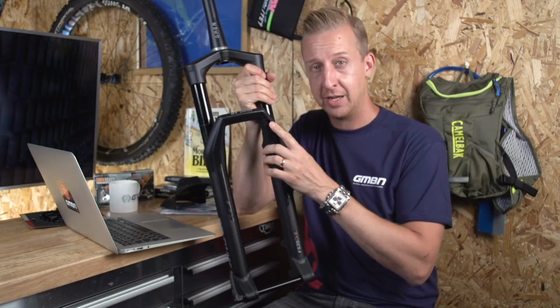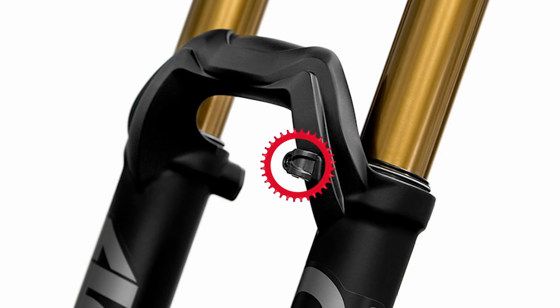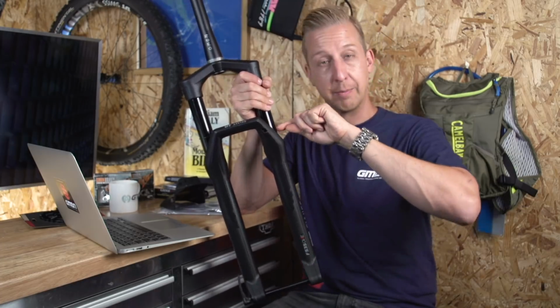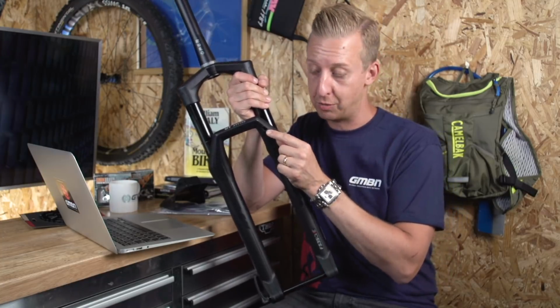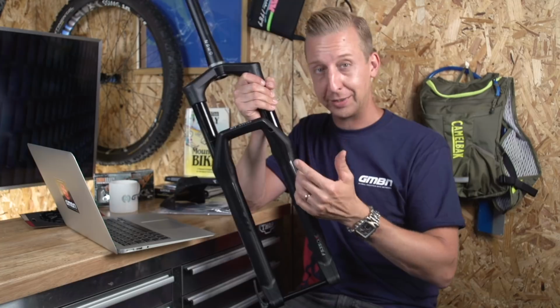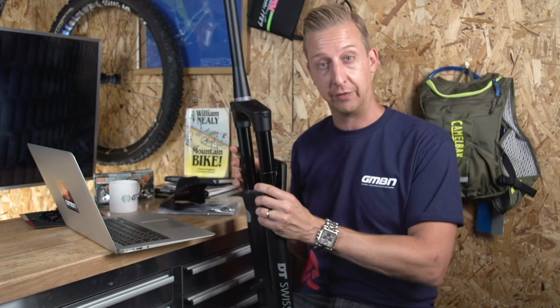The cable routing here for securing the cable to the fork brace itself. On most bikes, you have a little plastic clip that goes over the hose, and you have like a 3 or 3.5mm bolt that goes into the fork. Now it's very easy to strip the threads accidentally on that bolt. So what DT have done is they've got a route all the way through. The bolt goes in from the back, so of course it's replaceable. There's a little clip which is made of plastic to hold the hose. When you tighten the bolt from the back, it crimps down on the hose to hold it in place. And it comes with a spare one as well. So really cool thinking from DT Swiss there. Love what they're doing, and I can't wait to just have a feel of this to see how it is.